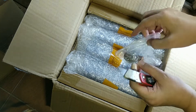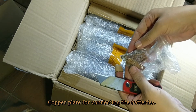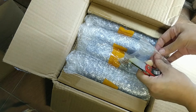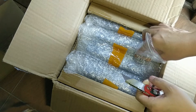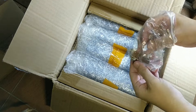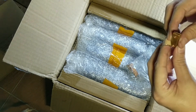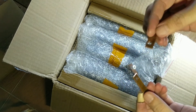While I'm unboxing, let me explain a bit about this project. The reason I'm doing it is because I'm trying to explore LiFePO4 batteries for cars and solar. The solar part I will post in a separate video when I have time to edit. As for cars, the most important thing about 12 volts is the CCA, or cold cranking amps. It needs to be high enough to crank up the ICE engines.